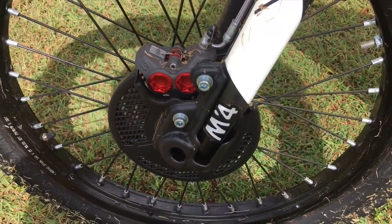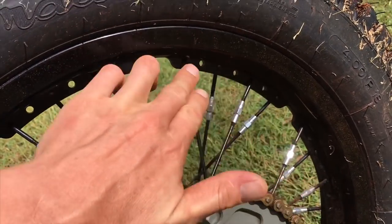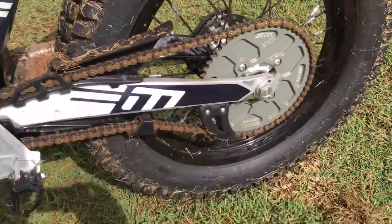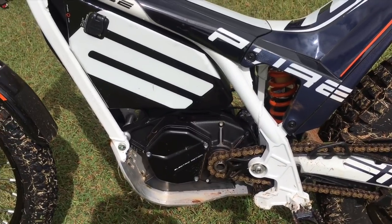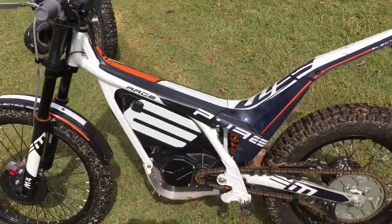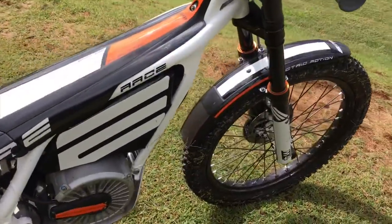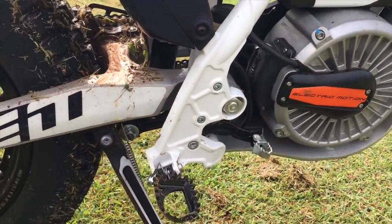On the race model you get an updated front brake and an updated rear wheel — more of a professional trials-grade wheel where the spokes are on the outside instead of inside the rim. You get a little different gearing: a smaller countershaft sprocket and a bigger rear sprocket, maybe a 48 or 50 tooth on the back, giving it significantly more torque. I rode both machines and this thing has some serious grunt — in the red map the sheer torque off the bottom is no doubt as much as a 450 motocross bike. That is not an exaggeration. Fit and finish on this is really nice; this is the high-end M4 aluminum fork that comes on the race model.